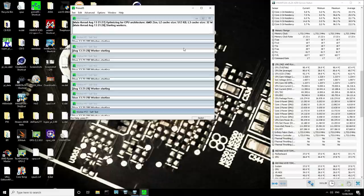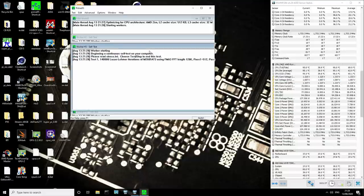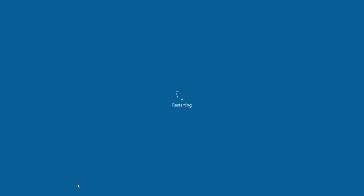Okay. Yeah, I really overshot it on the LLC setting. I overdid that. There's not enough droop. There's nowhere near enough droop. So we can just restart. That was like 10 millivolts of droop, which is, like, I was aiming for 70.